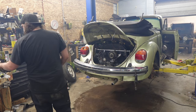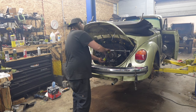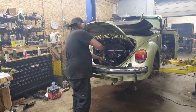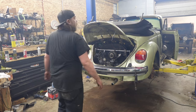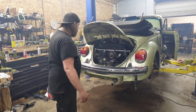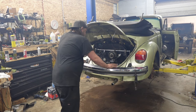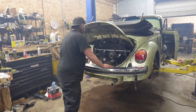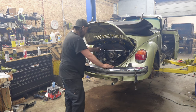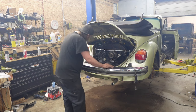I think we are dialed in. I like where everything is. Setting wise, tighten the distributor. I gotta let this place gas out. It is terrible in here. But yeah, lock down the carbs. All the settings are good. They're synced in. Gotta do some quick wiring for this oil pressure sender gauge. I gotta change out the oil pressure sender and just button up some wires.